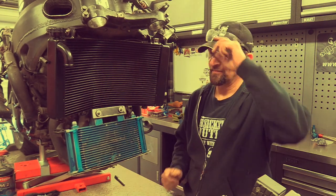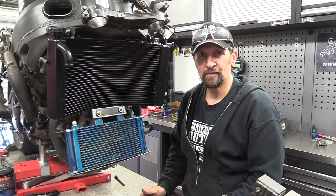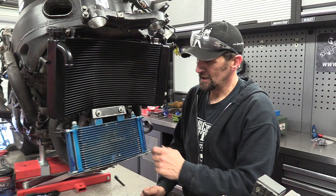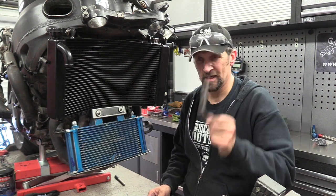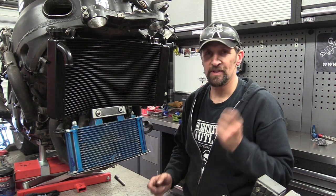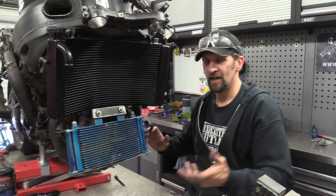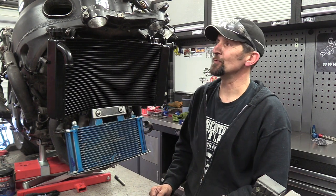Right, there we go, that's it. Everything done. That's the radiators mounted, beefy mounts, 3mm thick steel. None of these little pressed out bits of tin stuff. And adjustable. I've made the holes that everything bolts to 7mm for M6 fasteners, so you get that jiggleability that you can make everything fit and then nip it all up once it actually is screwed together.